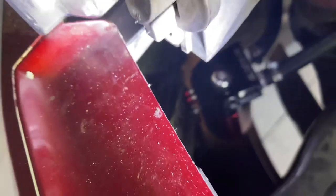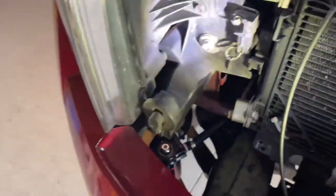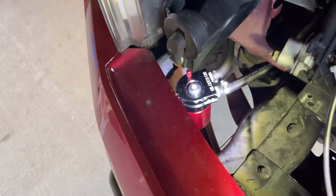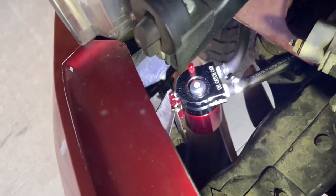I put clamps on both of them. What I did was take the support bracket off — there's a support bracket there that supports the bumper. I took that off, drilled it out, and put the two screws in there to hold it. There's a dipstick under here — you take this out and you can check where the oil level is inside the can. That's on the passenger side, down out of the way. To drain the can I can loosen it from up here or go underneath. I did have to drill two holes in that bracket but no big deal.